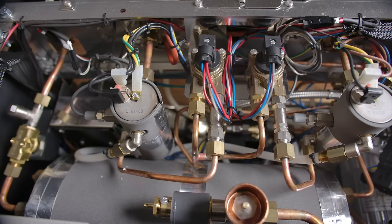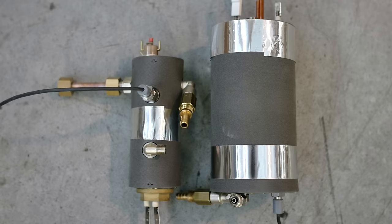We worked out relatively early that the temperature of the group head is way more important than the temperature of the boiler. You've got four and a half kilos of metal, but your brew water is only maybe 70 grams of liquid. So even if it's slightly lower in temperature, it'll absorb heat from that big thermal mass of the group head and come up to the group head's temperature before hitting the coffee. We took this as far as we could — we shrank the brew boiler down from about a liter to around 150–200 mils. Because you're not pre-heating that either, this small boiler takes it from cold to nearly perfect brew temperature, and then the group head does the rest. A huge energy saving.